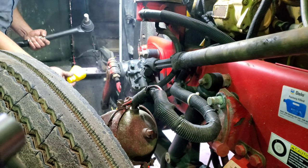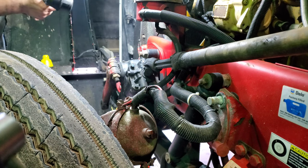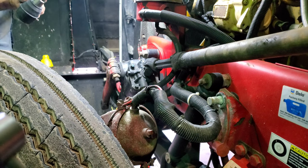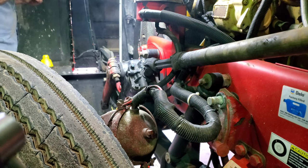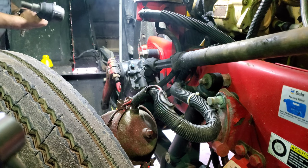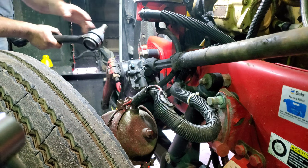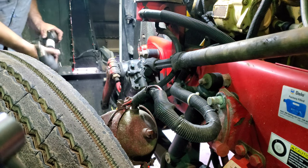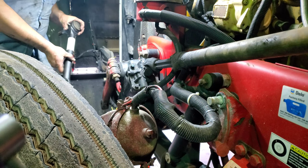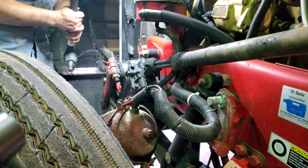This is what the new drag link looks like. They're going to have these little protective cups on it. The part number if you're looking for it — this is through Peterbilt — is J20-6005. The drag link comes with the castle nut but does not come with the cotter pins. Make sure whenever you do this, you have your grease fittings turned the correct way.